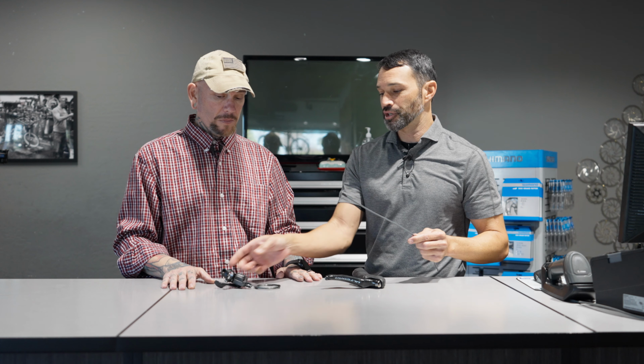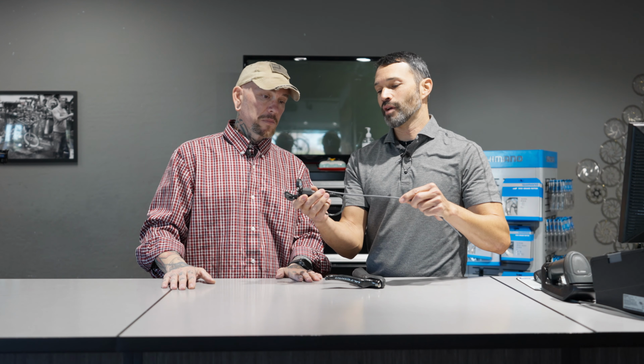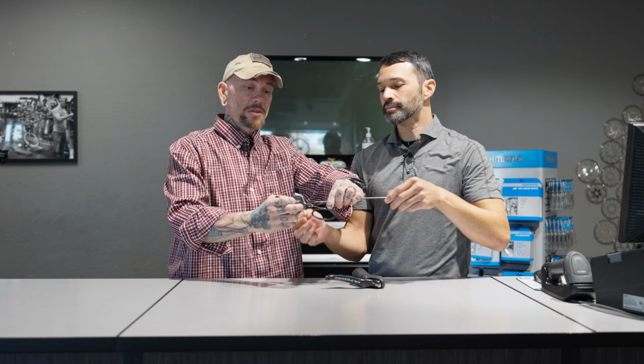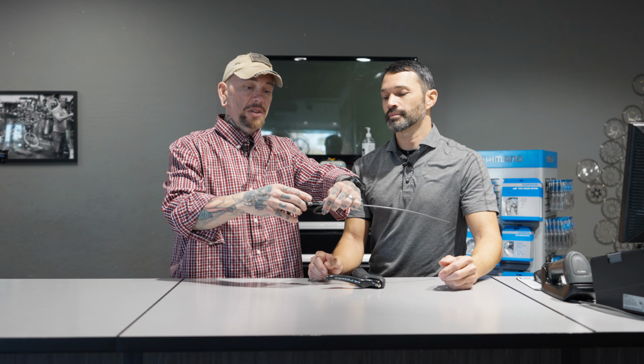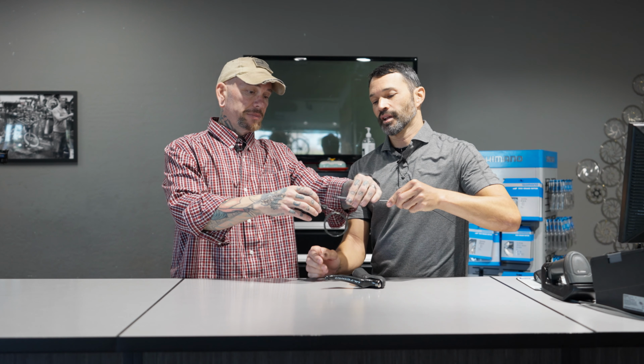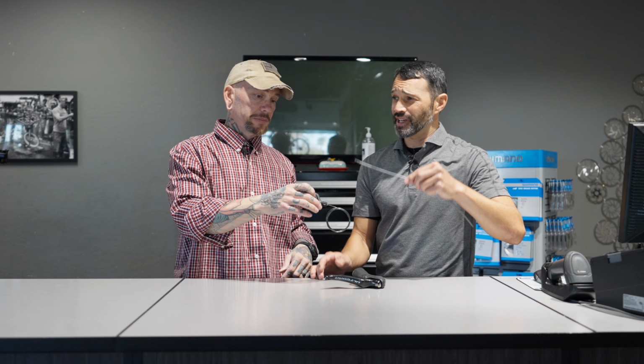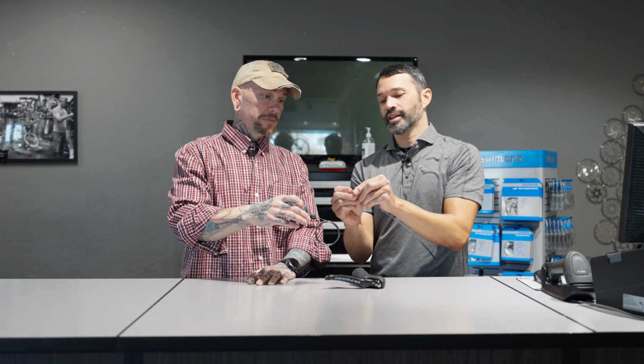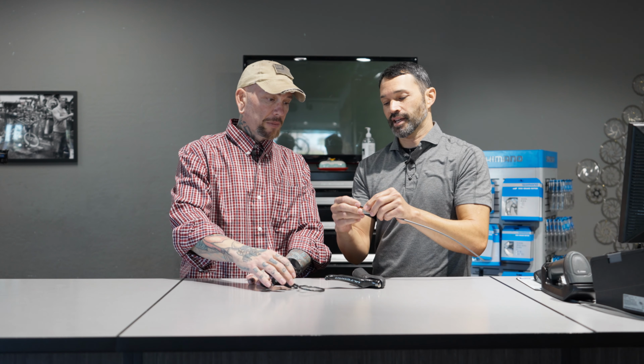While we're looking at the mountain shifter, what we see a lot is we have a plastic ferrule that sits inside here, and a lot of times just not being careful in how we pick up our bikes. Rotate that so everybody can see. So he's referring to a plastic ferrule that actually comes upright in here. We see a lot of times, just by people maybe bringing it in and out of their car, putting it on their stands, these little ferrules tend to break. Okay. Because they are just plastic, and when they do break, the cable starts coming apart. Shifting sucks after that.